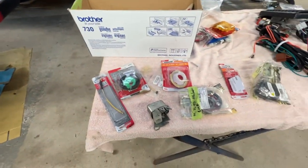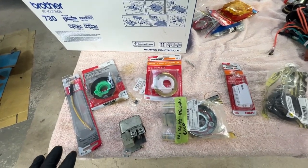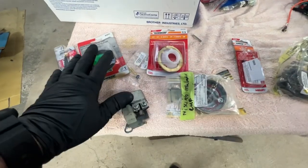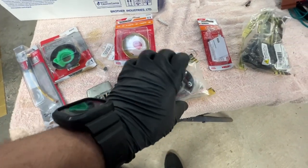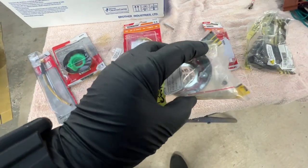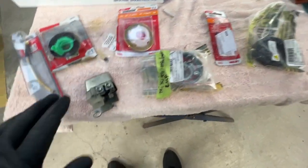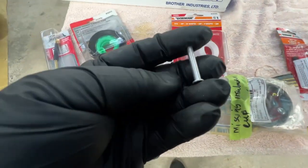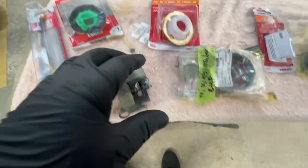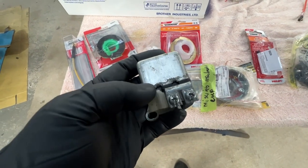I was able to get the battery drain and the faulty horn button fixed. It took a combination of a bunch of parts. The parts that were in it were missing some insulators, and I was able, through all my parts, to come up with what I needed to fix it. I also had to put a new contact spring and pin in it to make the contacts.